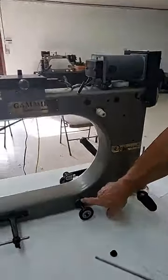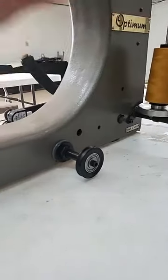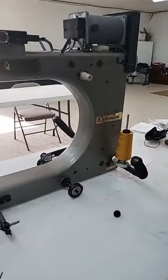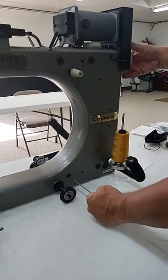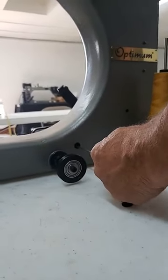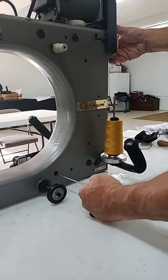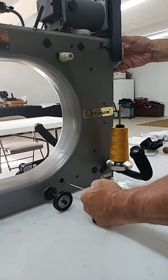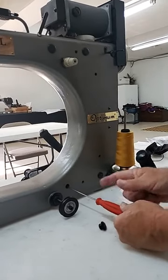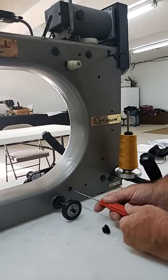Generally the hole is over your axle here in the back, your access for the collar that stabilizes that hook shaft. You take the rubber plug out, look straight in there and turn the hand wheel, and you'll feel a little Allen head screw inside on that collar. You're going to loosen that, pull your tool out and turn to the next Allen head screw. You can see those if you look up in there. Loosen that second one, but leave your tool in the collar. This collar can now move up and down.